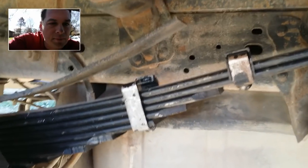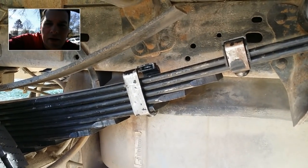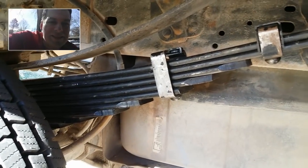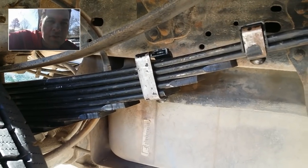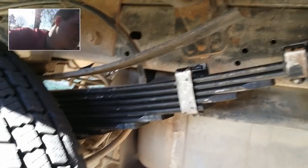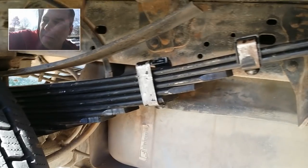I kept the helper spring. The previous springs on this particular truck are rated at, I think it's 3,840 pounds. But I decided instead of replacing with the same, I actually went one size up — this is 5,400 pound springs as far as their carrying capacity. I don't think I need that much weight increase, but it's definitely going to help with my future plans.